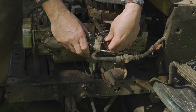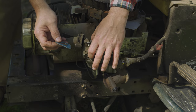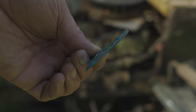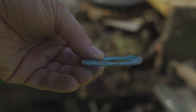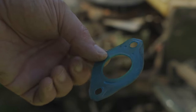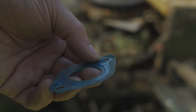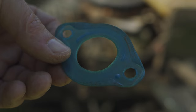Now the gaskets. The carburetor gasket is fine — no issues. Note that the intake here is also plastic, it's probably ABS. So it's never going to get to that 90°C because the ABS would start melting at that point. The fuel and air flow has not degraded the edges of the gasket in any way unlike any other gasket you would put in there. If you put a paper gasket in there, first of all it wouldn't be reusable, and secondly it would show the same sorts of wear. So this is my new go-to for carb gaskets — I can't think of any situation off the top of my head where this wouldn't work.